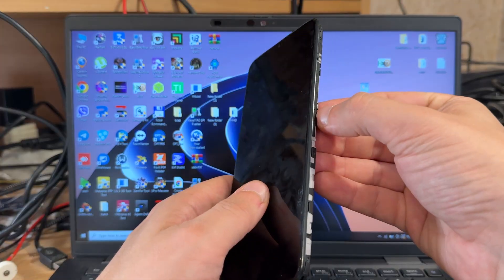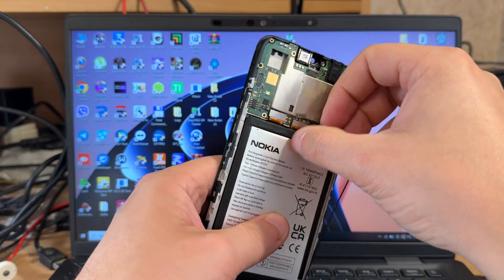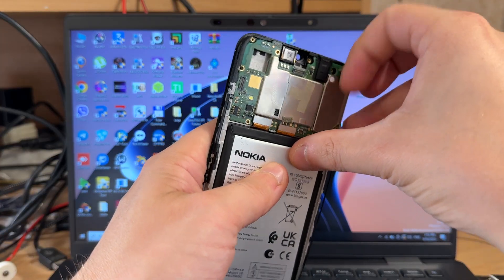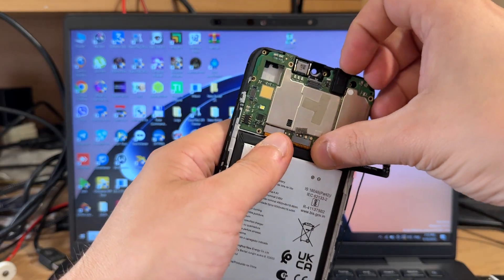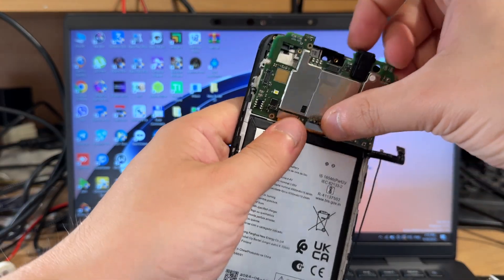For this operation you should disassemble the phone because a test point is required for B-ROM connection. I've already done this. Also, a little trick with the test point: some phones have no reaction when you connect using the test point.